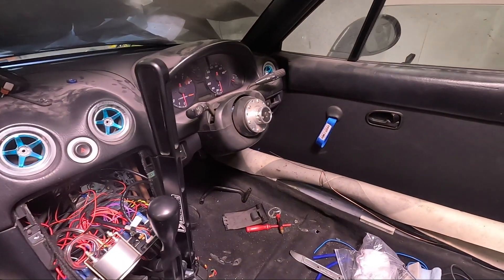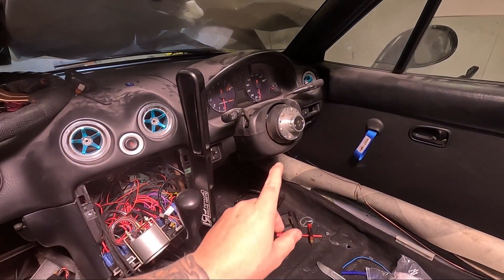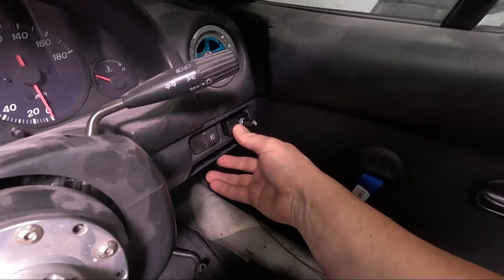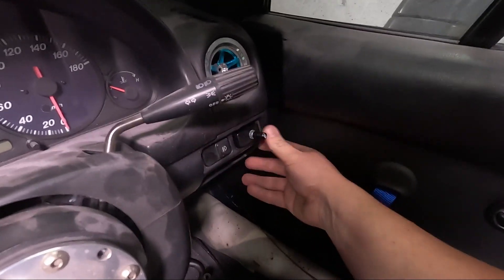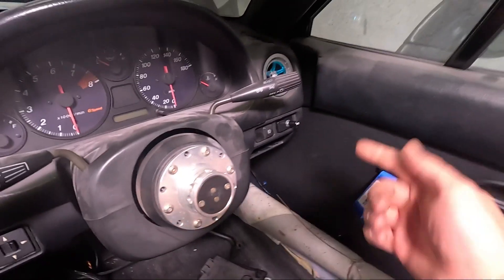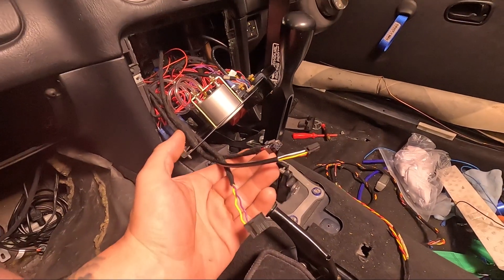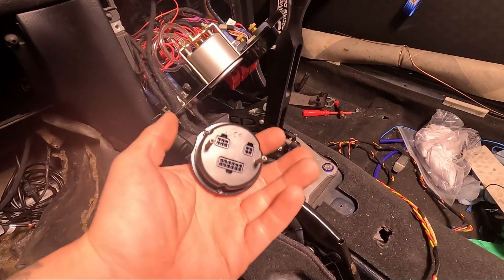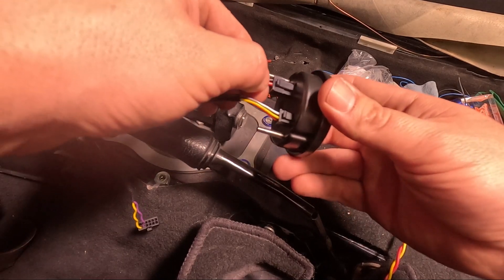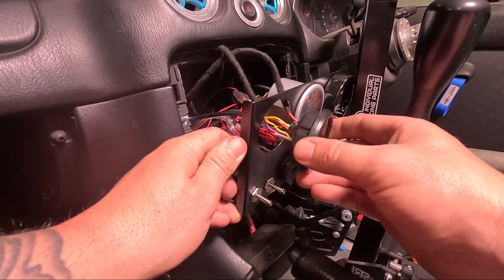If you're doing this, make sure the wires are tucked right out of the way — you don't want them chafing on the steering column and you don't want them in the way of your feet at the pedals. That looks really good there — nice and functional and easy to reach. So that's all three plugs wired up and run to the centre console. Time to plug them into the CAN Checked gauge: A for the remote, B for the power, and C for the CAN bus, then to put it in its home.